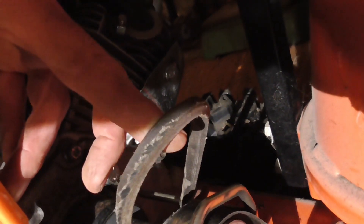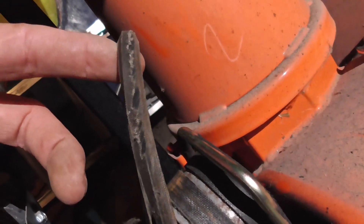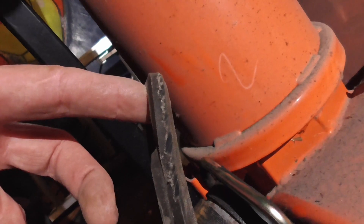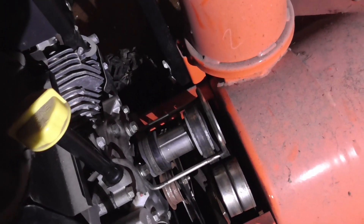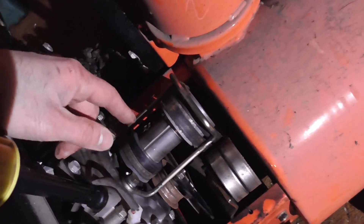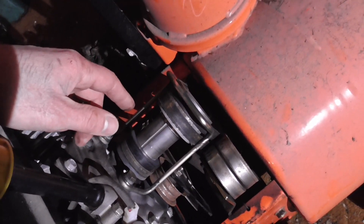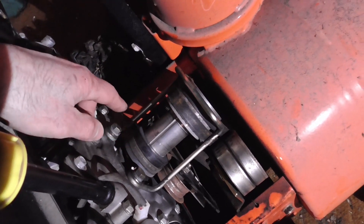It's not too bad at all — it could have been a lot worse. The damage is on the bottom, not the sides. V-belts grab on the sides mostly, so I believe she's fixed up and ready to go. It appears I did have to take the bottom cover off anyway — I would not have been able to re-route that belt without taking that big bottom cover off.